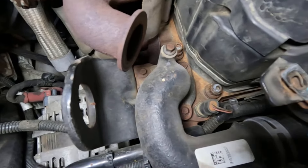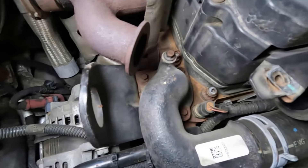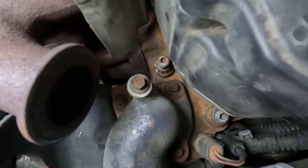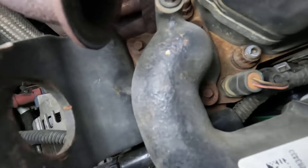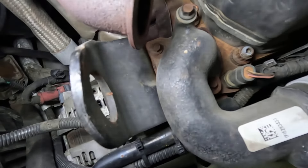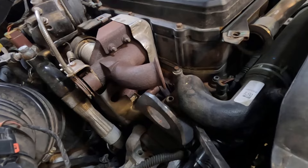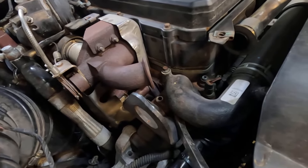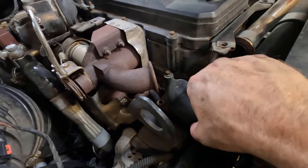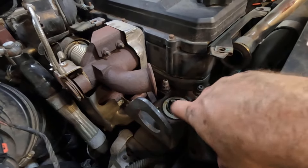We've got the cover off. The two little bolts right there you can just leave in there, because this cover has slots on both ends so you don't have to take your bolts all the way out. Next, you'll look down in here — we have one bolt right there, one on the back side, and one right here. Essentially you're going to have three 8mm bolts and we're going to take them out. Then we're going to be able to pick up on this thermostat housing and remove our thermostat. All right, y'all, got the three bolts out. I'm just going to take a pry bar right here up under that housing and just gently pry up on it, break that loose. You can kind of pick straight up on it and pull this thermostat housing out of your way.